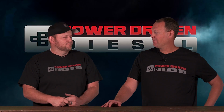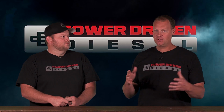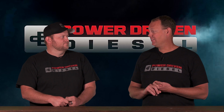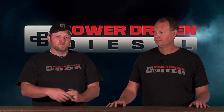I remember reading about this in the forums when I got my truck like 10, 15 years ago. The Chevy 1-ton rear cylinders is like the go-to mod. It's super cheap. It's easy to install. So if you have a second-gen Dodge out there, toss your rear cylinders and get a Chevy 1-ton, be a lot better. So we put those on this truck because we want it to be able to stop.